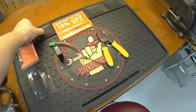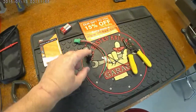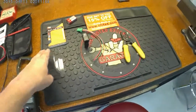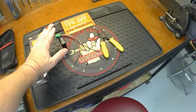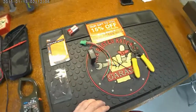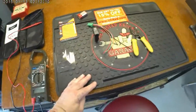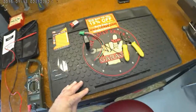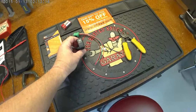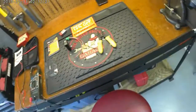I'm going to use this 9-volt battery to kind of play with the wires and see the way I want to wire it, and to see exactly how the lights on here are going to light up, basically the way I was talking. I'd like it to be completely dark, even with the dash lights on, whenever the vehicle stability control is normal, and I'd like the whole thing to light up, if I can, whenever I've interrupted it. And that way it lets me know, danger, Will Robinson, that I have this switch on, in case I can't see it on the dash.